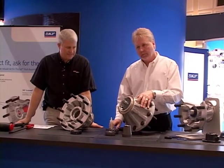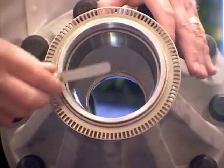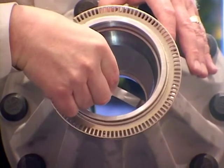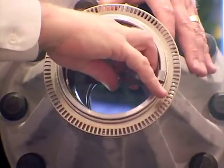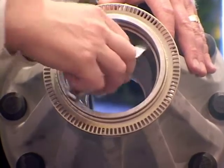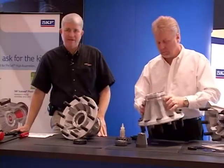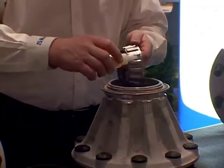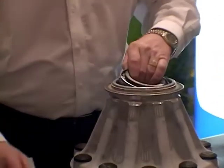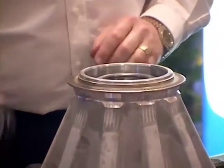When the race is installed, it's very important that it's seated fully against the bearing shoulder in the hub. To check that, we use a one-and-a-half to two thousandths feeler gauge to ensure it's fully seated. When you're comfortable that both races are seated, we're going to lubricate the bearings with the lubricant that's going to be in the wheel end. Installing the inner bearing first, we're next going to install the seal.